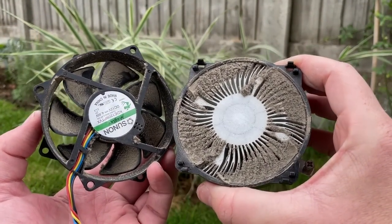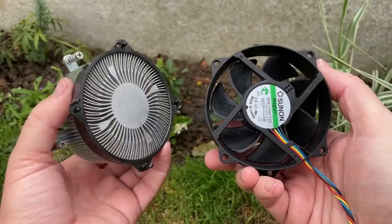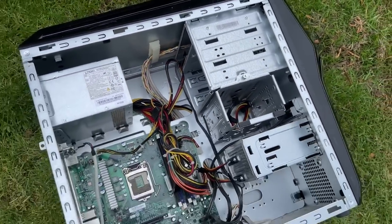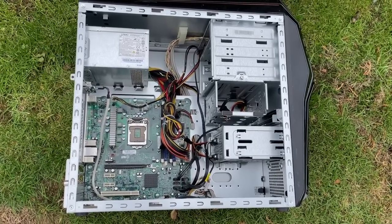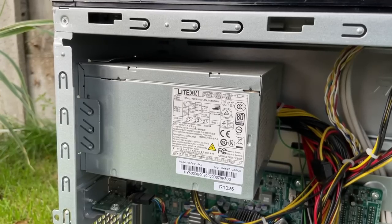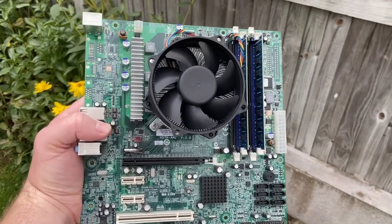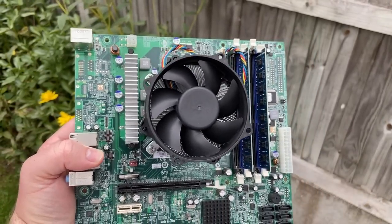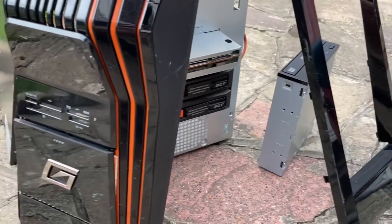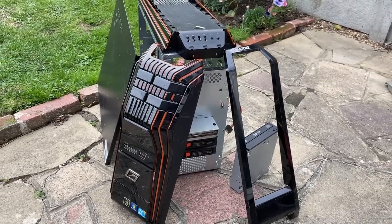You know how when a new product releases and it's good but there are already better options available and paying a little more would go a long way. That said, there was and still is room for upgrade. A first-gen i7, a RAM upgrade, and a low-cost 10-series graphics card would transform this from a sluggish old pensioner into a slightly younger pensioner who can still run the odd marathon. The 450-watt 80 Plus Bronze PSU will allow for this too. Acer also used standard-sized parts — none of that proprietary nonsense — so you could swap the board out as well and build a sleeper machine inside what is still a great-looking enclosure. If your G5900 is dusty and dirty like mine, the whole thing can be stripped down pretty easily; after a couple of hours cleaning it and scraping off rust patches with wire wool, it was good as new, sort of.